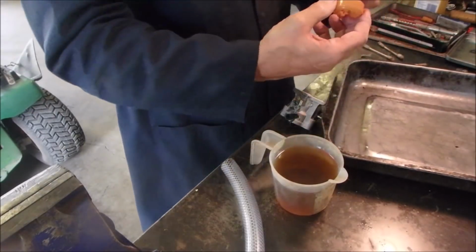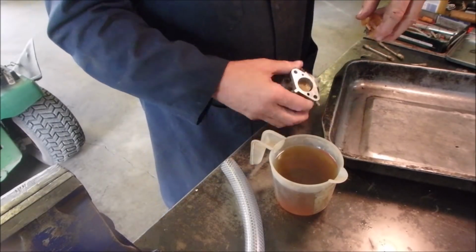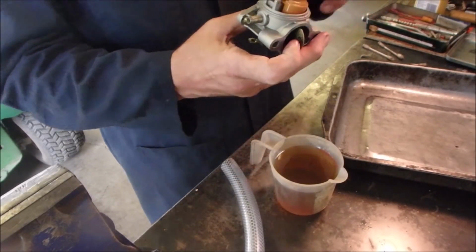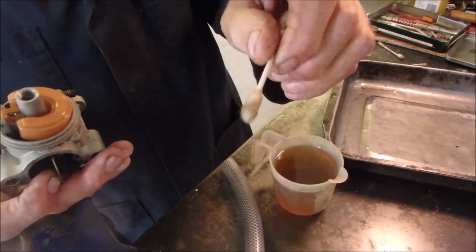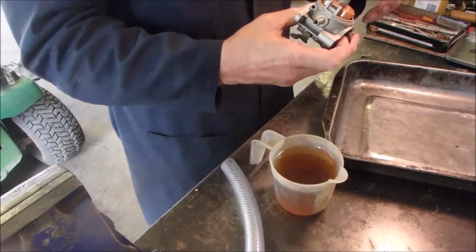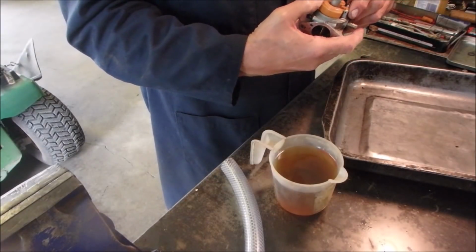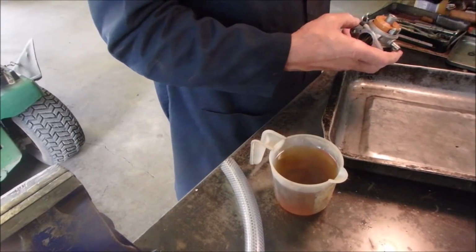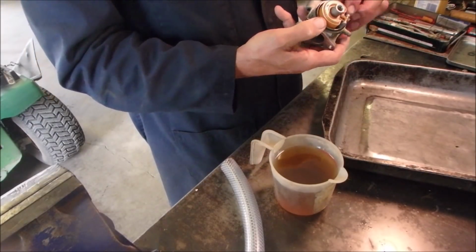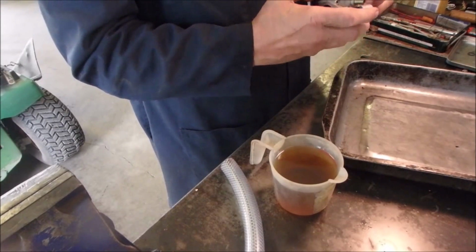I've cleaned the whole carburetor very well. The passages are so big, I don't even know if an ultrasonic cleaner would make much difference. And I really made sure, Donny Boy did a good video on this, that there are no cotton hairs from these guys getting into your needle and seat. Then I'm going to not put it in the machine. I'm going to hook it up to a gas tank and just let it sit for X amount of time. We don't know what X is.